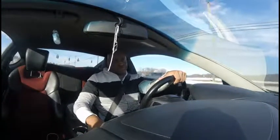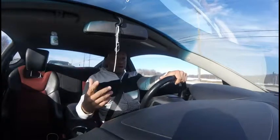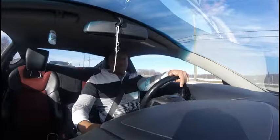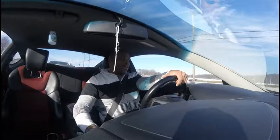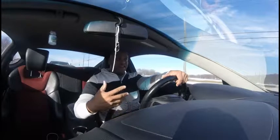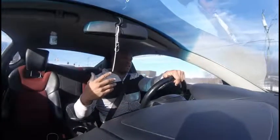The next thing I did was the ACT flywheel and ACT clutch. The reason I had to do that was because the bearing in the flywheel had worn away. I bought the car with about 55,000 miles on it, and after about 30,000 miles that bearing finally went. It was causing the car to shake at stops and it felt like the clutch wasn't there — I had to push all the way to the floor to engage it.